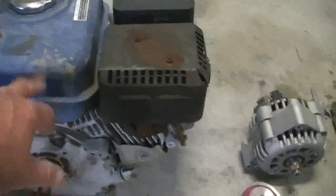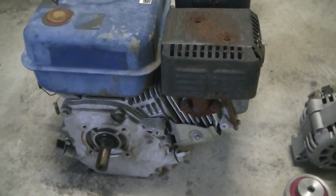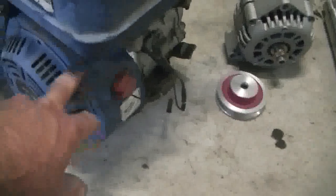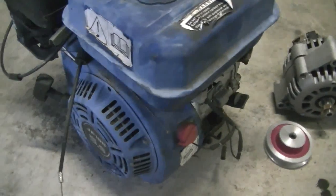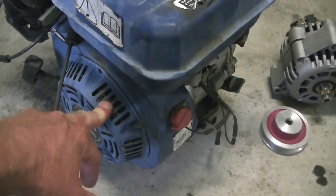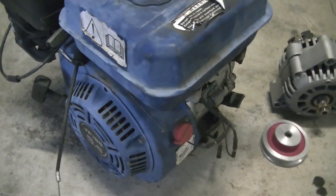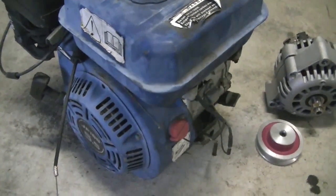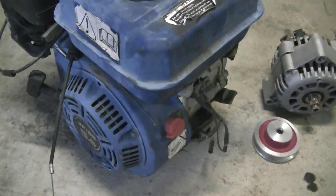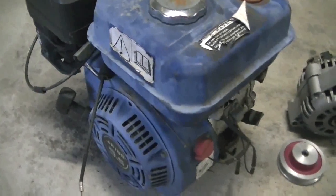I have three or four of these motors. There are modifications that have to be made to them before you can run them on hydrogen. In behind here is our ignition coil. They have what they call a waste spark. When you're running it on fuel it's set at 4 to 6 degrees before top dead center. The waste spark goes off when the exhaust valve is open, which is not a problem when running fuel. However, when you switch to hydrogen you have to retard the spark to about 2 to 5 degrees after top dead center. That waste spark will then go off when the inlet valve is open, and that's exactly what we don't want.